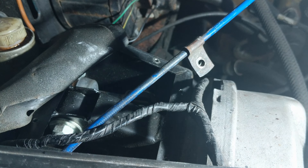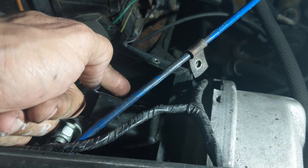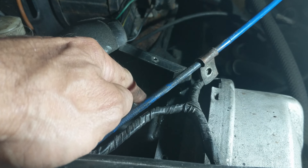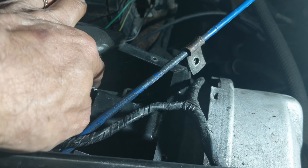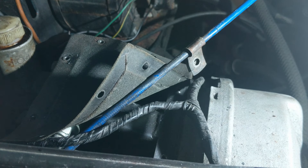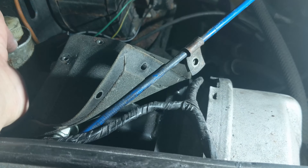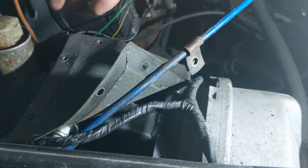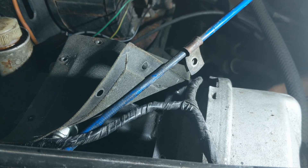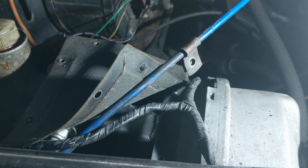Okay, let's try to work through this again. We have here — this is the pedal pivot pin. This is the push rod that goes into the master brake cylinder here. That going in should cause fluid to head down this pipe here. You can see it comes out the back, and there is a pipe just behind here that takes it down to my slave cylinder.